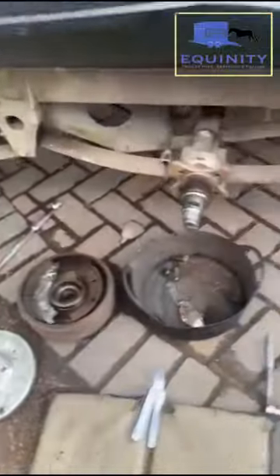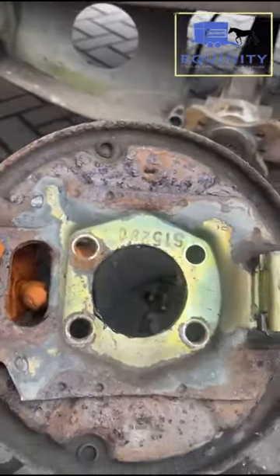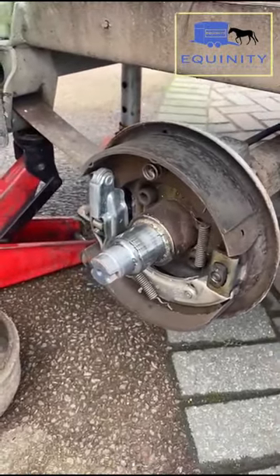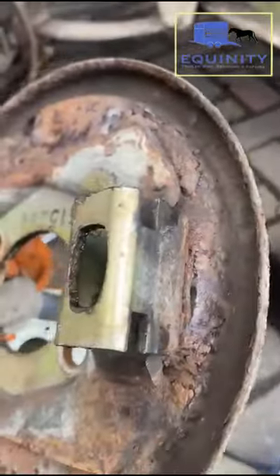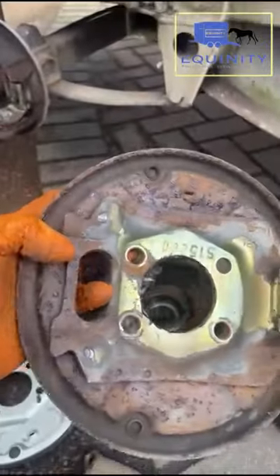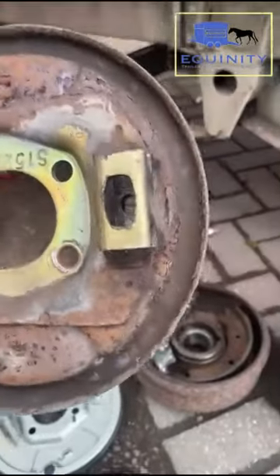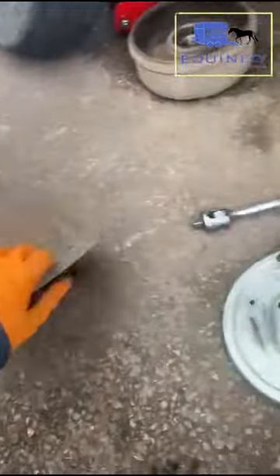On the brakes — this particular trailer has a hole in the black backplate. This is the bit that attaches the brakes to the trailer. That's the brake shoes and all the components inside that attach to the backplate. This backplate has a hole in it, and if left, it's going to get worse and worse. As you can see, there's quite a bit of corrosion — that would eventually corrode right the way through and fall off, leaving your brakes with nothing to attach to. This is why it's important to have your brakes serviced and checked on a regular basis.